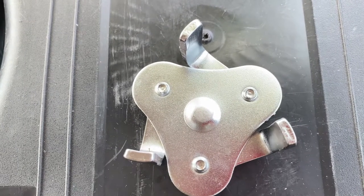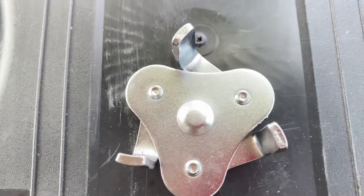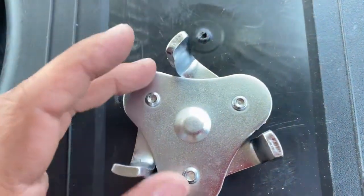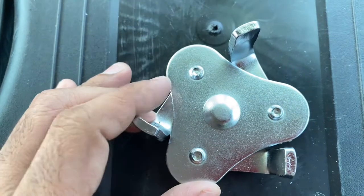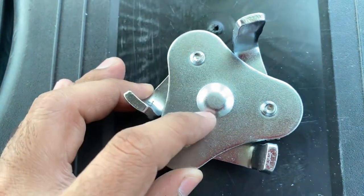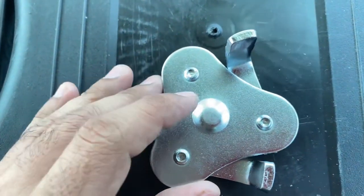You extract the oil through the oil dipstick and just add the fresh oil. Before that, you need to change the oil filter using this tool, which is also very easy. Everyone can try this — it's not very complicated, and it's not something only engineers or mechanics can do.